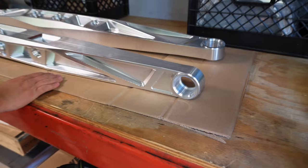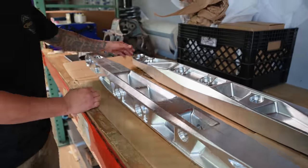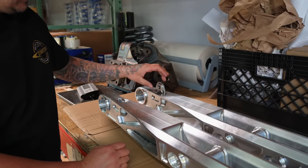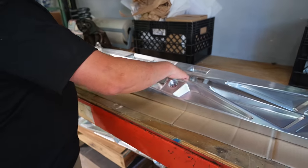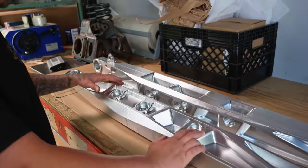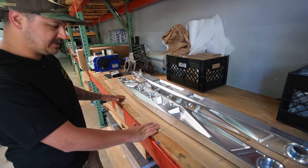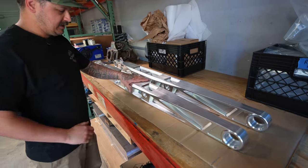It's a one-off length compared to what we usually make — sway bar location, coilover, bypass, limit strap, which actually this one has the tab in it. So we machined this tab to drop in and then put two bolts in here and you attach your limit strap to there. Pretty cool set, a little different with the added features here more than what we usually do. We run our limit straps off the housing and our sway bar off the housing as well.